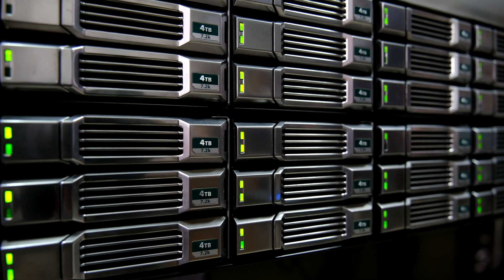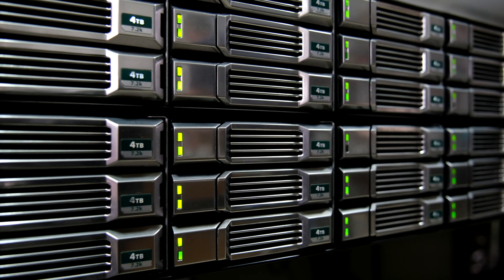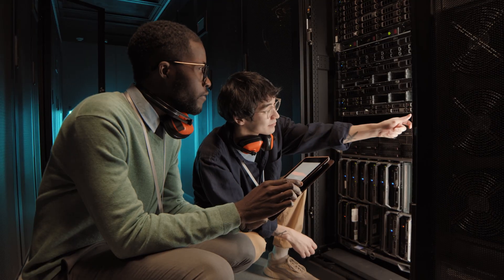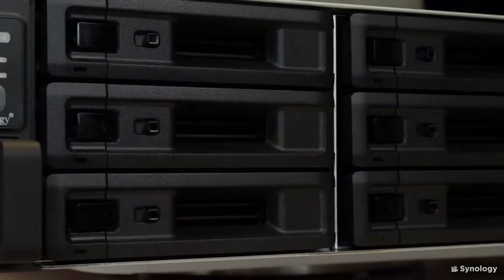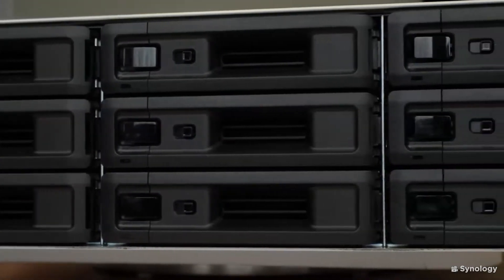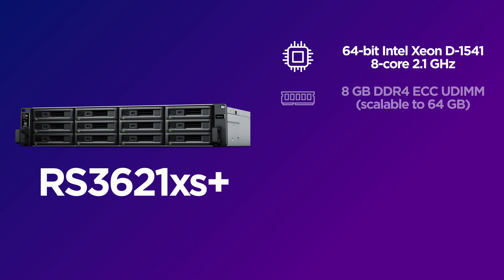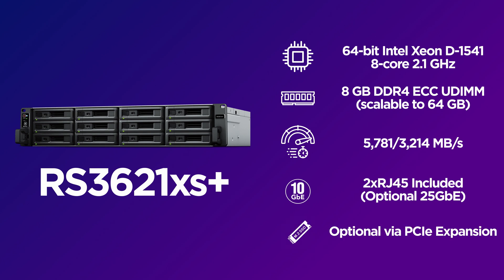Jumping from desktop tower format NASes, we're now looking at rack-mounted NASes which support 10 or more users. These NASes need to be housed in a comms cabinet, ideally in an air-conditioned comms room somewhere in your building. You'll also want to place this NAS close to your network switch because they're not easy to move around. The RS3621 XS Plus is another XS Plus NAS and a step above the DS1823 XS Plus. It has an Intel Xeon D-1541 8-core 2.1 GHz CPU with 8 gigabytes of DDR4 RAM, scalable to 64 gigabytes — and again, I highly recommend upgrading your RAM. How far you go toward 64 gigabytes depends on how many users you expect; the more users, the more RAM.